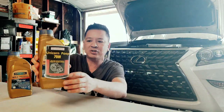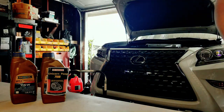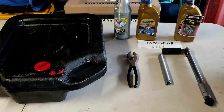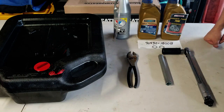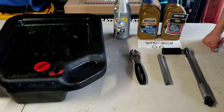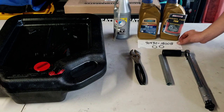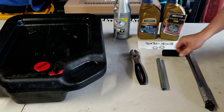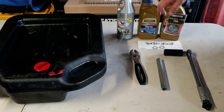To get started you're going to need an oil drain pan. You're going to need about one and a half quarts of transfer case fluid — it doesn't matter what kind. If you do use Ravenol, you'll probably need a pair of pliers to take off the cap because I couldn't do it with my bare hands. You're going to need two brand new washers for your drain and fill plug — I'll show you the part number. You'll also need a breaker bar, a cheater bar, and a torque wrench with a 24-millimeter socket.